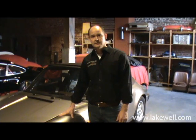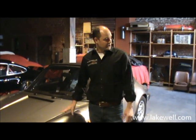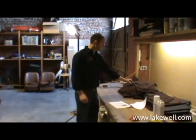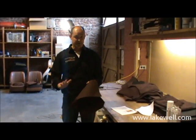This is a carpet set which for this particular model has 24 pieces. This is a 911 convertible 1984. But of course, several variations between carpet sets in this particular era exist. So while this instruction is suitable for all the years, you have to make some allowances for certain variations. Now the carpet set is an OEM specification carpet set made in Slivernit, which is a very flexible material. And that flexible material allows you to follow the contours of the floor pan of your 911 to perfection.